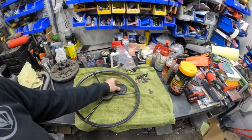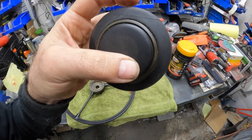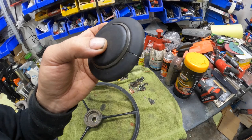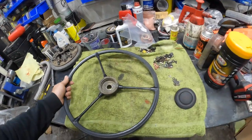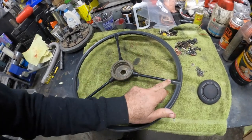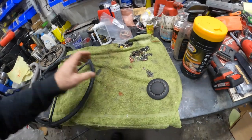One of the next things we have to do is look at the steering wheel and horn. Unfortunately the horn has a dirty great big crack in it and a whopping big crack across there. That piece there has been repaired before and is literally dangling by a thread. Let's get that repaired. I'm going to experiment - I've got some old Bakelite and I was thinking of grinding it up into a powder, mixing it with some epoxy, putting it into the crack, and seeing if we can blend the crack out. The steering wheel itself is in really good condition. I'll sand it lightly and polish it up, repaint the inner parts, and clean up the hub as well.